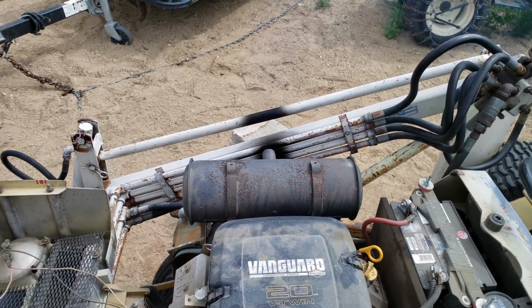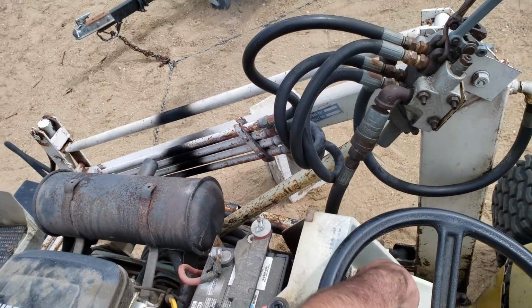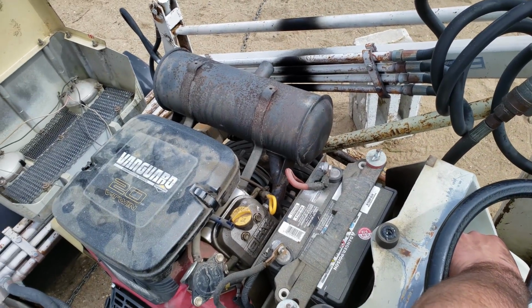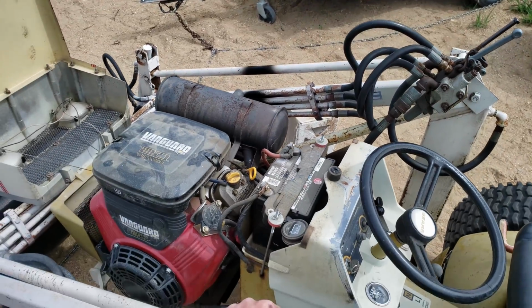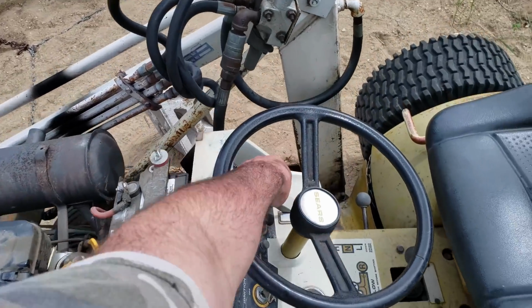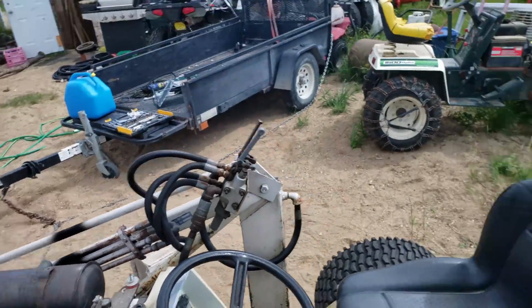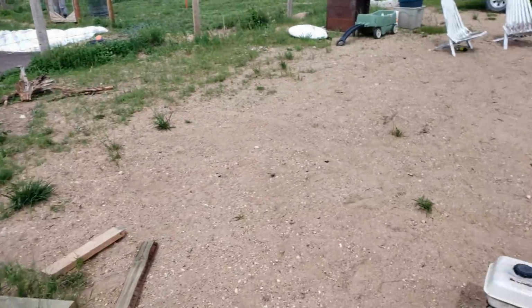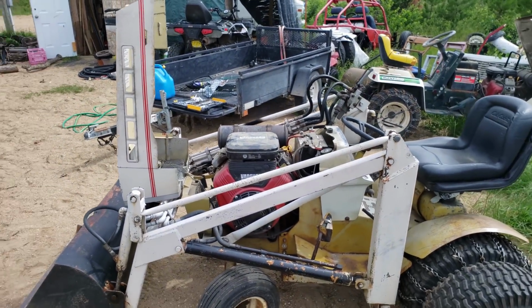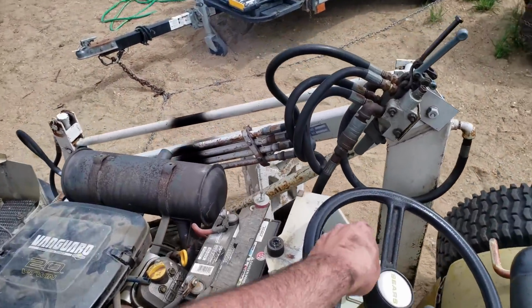A little bit extra in it right now, which is probably why it's smoking, but no, now it's on 2 cylinders. It might have cleared itself out. Again, that exhaust got filled up with smoke from the crankcase filling up with gasoline, so a little bit of smoke still now, you see, on lower RPM. I think it's only running on 2 cylinders at high RPM.